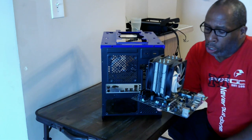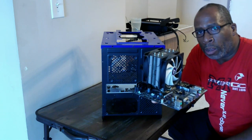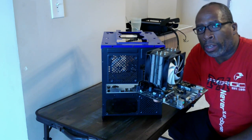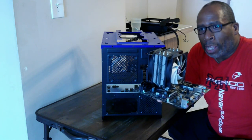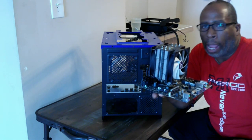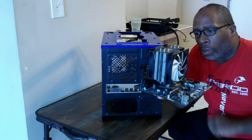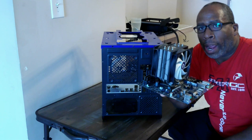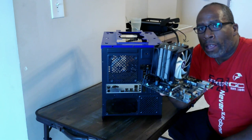Now, the motherboard of my choice was an ASUS A320MK. Keep in mind, I did a video saying that AMD is abandoning all 300 series. Here's the thing: they did do the update for the motherboards. So if you're on any A320, like I'm on ASUS, or other manufacturers, look for the latest BIOS, because this motherboard now supports all Vermeer CPUs. That is the Ryzen 5 5600, the Ryzen 7 5700, and the Ryzen 9 5900.